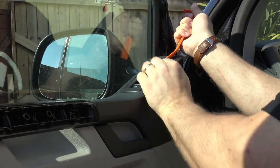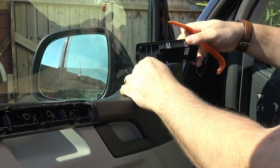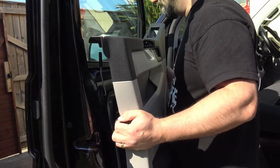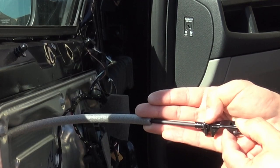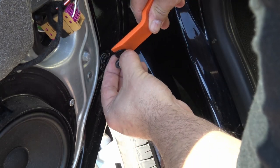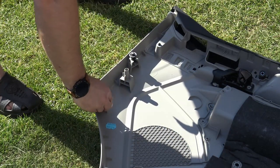Obviously there are electrical switches — electrical contacts — which connect to the window switch. So go ahead and disconnect those. They're little pull tabs, dead easy — just little press release latches. Once you've got the door card off, this is the fiddly bit. There's a little release mechanism which allows you to release the door handle mechanism, which is a bit like a bike cable. Once you've done it once, you'll figure that out. Those door poppers have a tendency to stay in some instances and not pop out properly. So get another little pry bar and replace those — pop them off and then stick them back in your door so that when you refit your door, everything goes in place properly and everything lines up well.